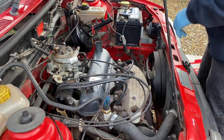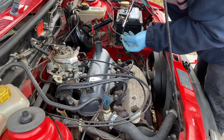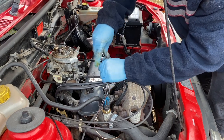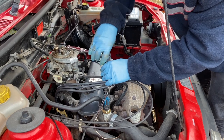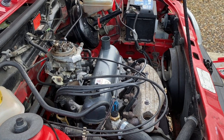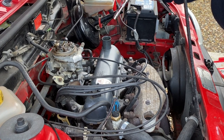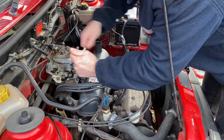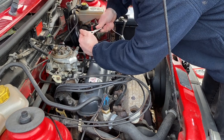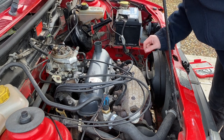Okay, it's all lined up. Let's get these screws in and actually tight this time. I suspect there is a torque setting for them, so I'll just put them in finger tight for the moment and go and find out what the torque setting is. I've had a look at the Haynes manual and the specified torque for these bolts is four to five Newton meters. However, my torque wrench doesn't go that low — it only goes as low as 20 — so it's just going to have to be tightened by hand until it feels tight. And that feels quite nice now. I'm going to say that's four to five Newton meters. Right, let's just get the air cover back on and call it a day.